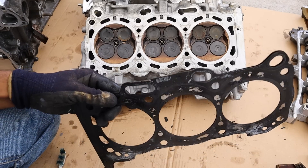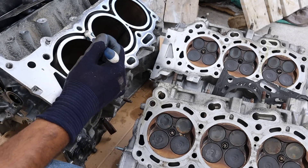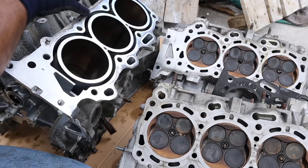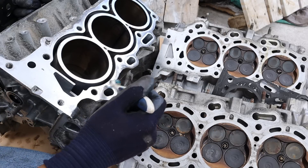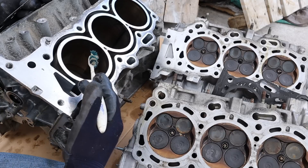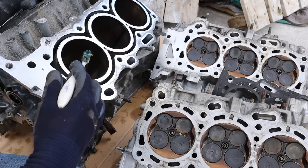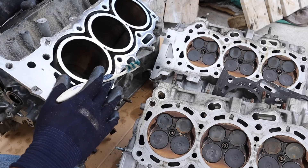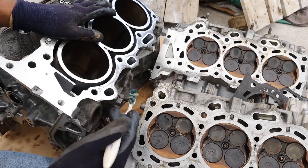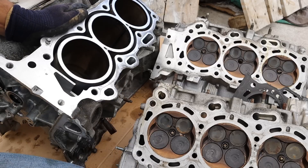It just comes out looking like that. When your head gasket becomes compromised, the coolant from the outside of this jacket and around the head is going to mix with the oil through either the oil pressure ports at the top or the oil drain back, and that's going to cycle coolant through the oil. Coolant can attempt to do lubrication, and oil can attempt to do cooling, but then you end up overheating the engine. Most cars would automatically shut off to prevent engine failure in the event of overheating, but this owner probably took it a step further and literally drove it to hell.